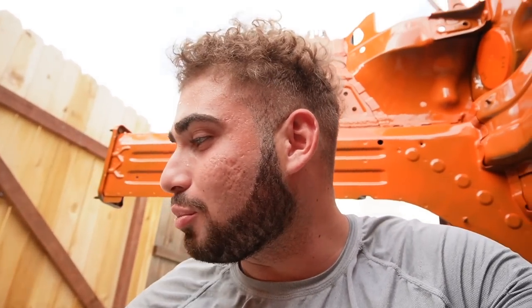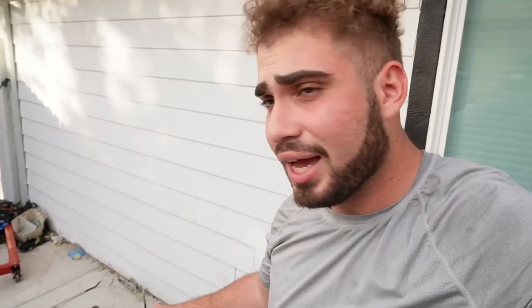I'm smiling so much right now. I cut this out perfectly and it looks amazing. A lot of people told me to go with an aftermarket bracket, but how sick would it be to actually have an OEM bracket? We're 50% complete, but this would literally be an OEM transmission tunnel. Obviously there's going to be welds down there, but with all the weather shielding and heat shields, you're honestly never going to see it. When we bolt on the transmission, it's going to go into factory holes and you'll never see the weld marks — unlike a custom bracket which would still be visible underneath the car.